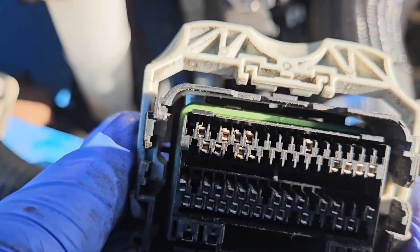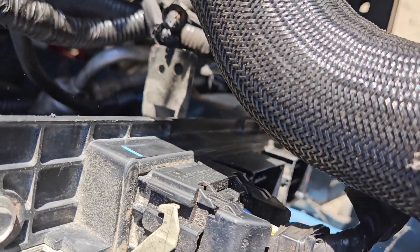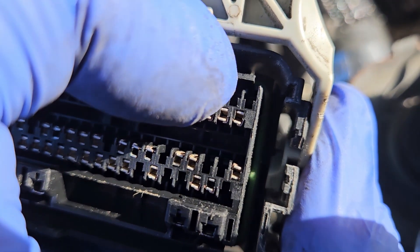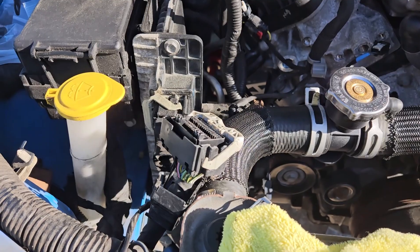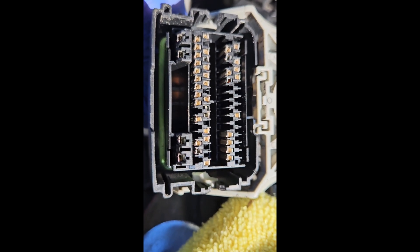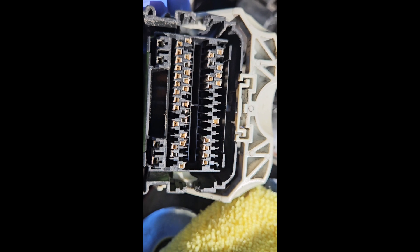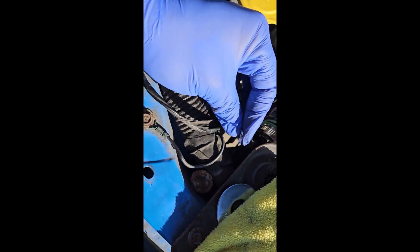So I'm going to confirm here. Pin 2 is going to be the second one from the end on the top. I'm going to grab pin 40 to demonstrate. You can see the pin right there — that's pin 40. You're going to de-pin it from the front or the head of the connector. Stick the pick tool in just above the pin, give it a little wiggle or put a little pressure on it, and then you can just pull it out. There is pin 40.